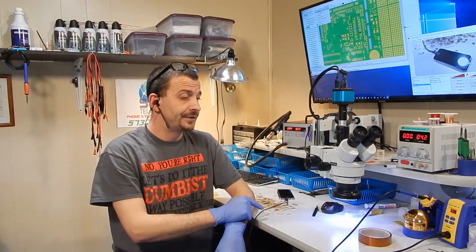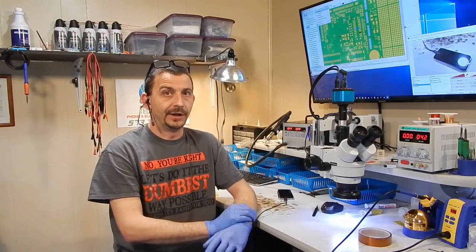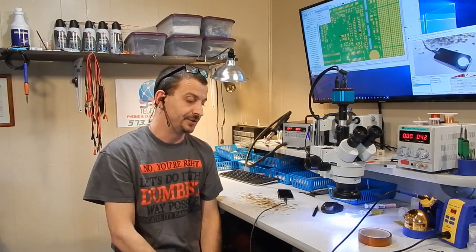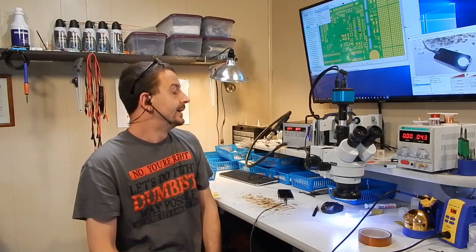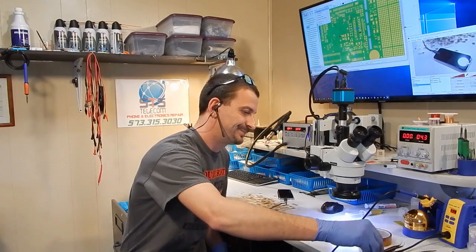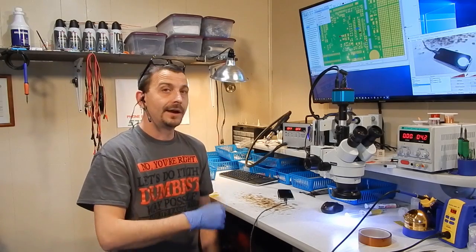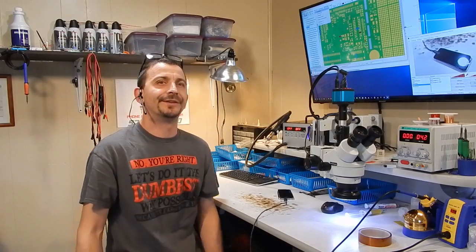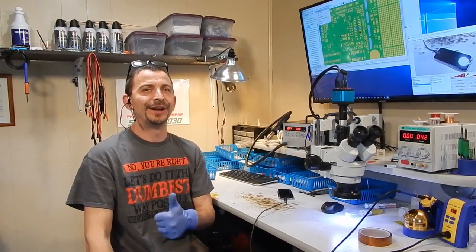I didn't have to put that filter there - I could have left it out. But then if that wire got shorted, sparks will fly - they smoke instantly and the next guy is going to wind up replacing all that other stuff too. So for the ease of repair I could put a lesser value fuse at the end of my wire. But this is a good repair - I have protected the rest of the phone and the backlight works. That's going to be it for this video. I hope you all have successful repairs and thank you for watching.